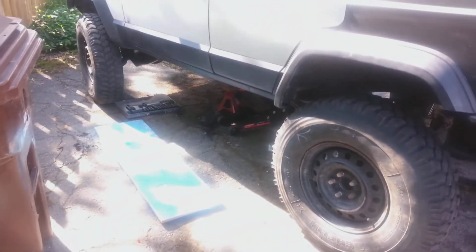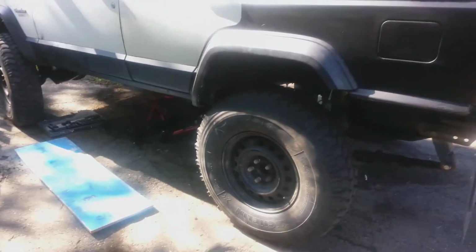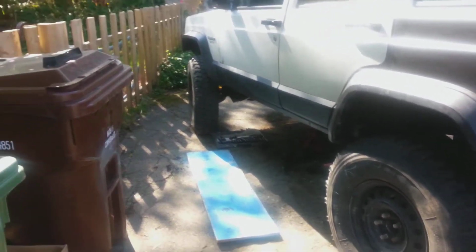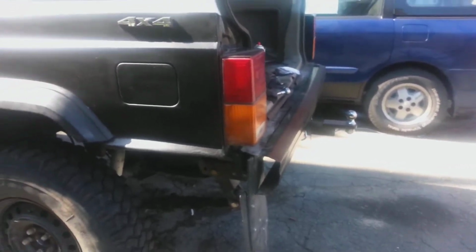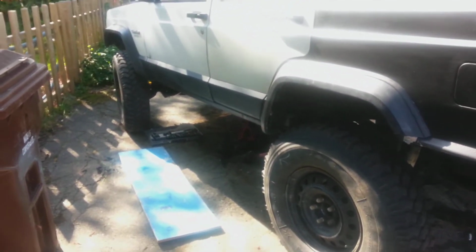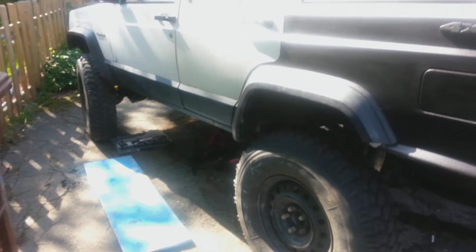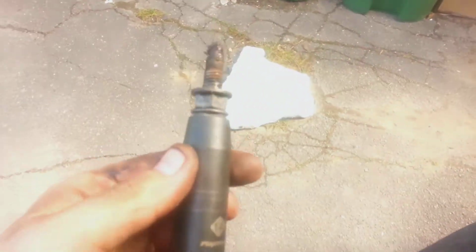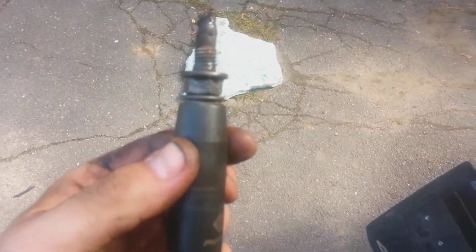I put some vice grips on the stud, and it doesn't seem like it wants to come out, so I'm going to have to do the 2-bolt trick and hit it with the impact. But for that, I'm going to have to go to Ace or Canadian Tire with my wife and go pick up 2 bolts that'll fit on there. Thank the Lord, it's a beautiful day. So, put 2 bolts on there and I hit it with the impact. Out she came. Everything's out.